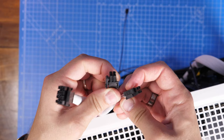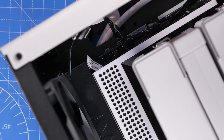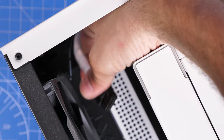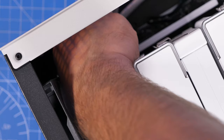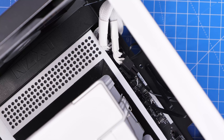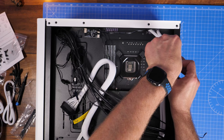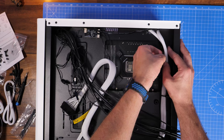The CPU power connections — one of the cables can be split in half because we need an eight-pin and a four-pin. I tidied those up earlier on the right-hand side of the case, but now I need to run them in. This is one reason you might be better off installing the tower cooler after the motherboard is already in the case, because with the tower in the way the power cables are really fiddly and hard to get in unless you have small hands. My recommendation: install the motherboard first, plug in all the cables, then install the tower after.